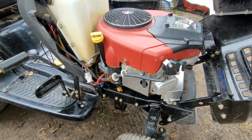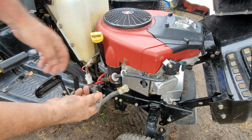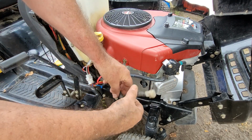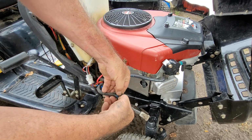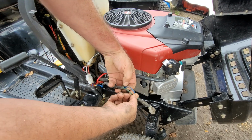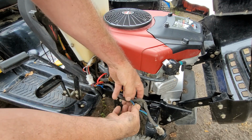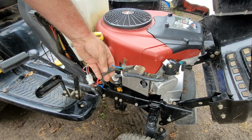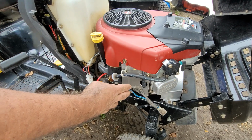All right, got you back here. Let's work on headlights. This one has no wires for any of the headlights, and this loom looks a little smashed and blue wire damaged, green wire smushed. I think we'll cut it there. I don't have the original plug that attached to this anyway, as much as I like to use original plugs and stuff. We'll cut it back here.